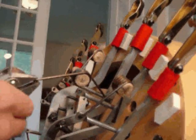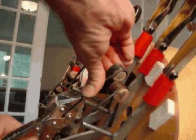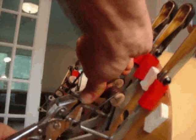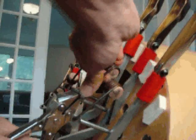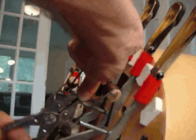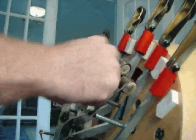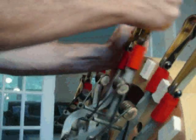Now I just need to put the spring back on the stud. There's a little notch in this end of the spring that helps it stay where it belongs. Sometimes it's a little bit of a challenge to get it lined up just right, so just try to hold it and keep it from popping off at you. You should hear a satisfying snapping sound when the notch gets in where it goes. There we go — it's sitting in where the notch is sitting in the stud, and it should stay put just fine. If you had a creak in that spring, it is most likely going to be gone when you get done with that.